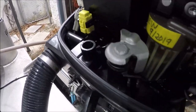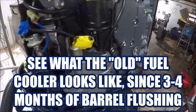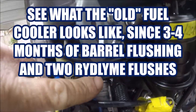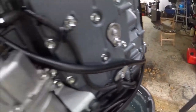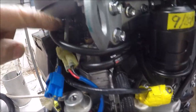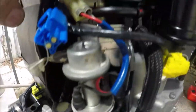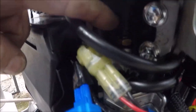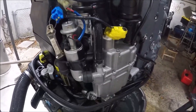I'm just checking around to see what the story is. I'm going to check my old fuel cooler. See, these are the lines right here bringing water to the fuel cooler from right here, and that leads around the back, goes up to a splitter, goes into here, then goes in there. At the very bottom of your fuel cooler there's the drain line that goes out. At the top, right there, is where the fuel is going in. I put my fingers on that to feel for any temperature difference, but I don't feel anything — at least I know it's a brand spanking new one going into spring and summer.